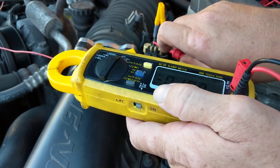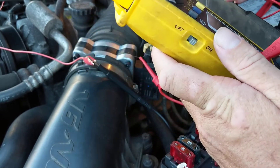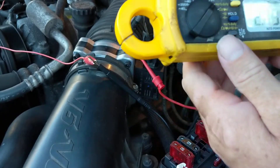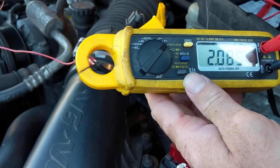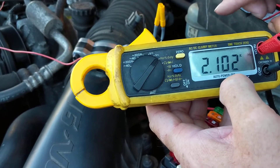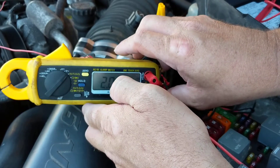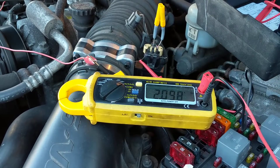So we're going to go here using my method. Now, as you can see, this is in volts — we're going to change the scale to hertz. Look at the scale: 2 kilohertz. That represents the signal going from here to the computer. Let's put it in a safe place so you can see it. Let's increase the RPM.